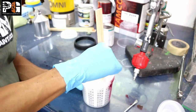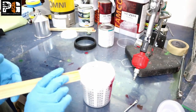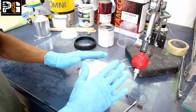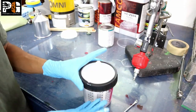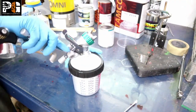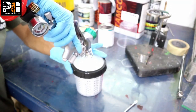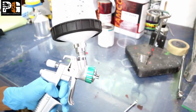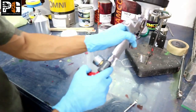The paint is mixed up. I'm going to put my cap on — the filter and cap — and screw this on. Then I tip the gun over, push in, turn, and that is your quick cup system ready to rock and roll. We're going to go ahead and shoot the hood. The game plan is to make the middle black but start by giving the whole thing a white base, starting on the edges and coming in.